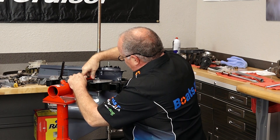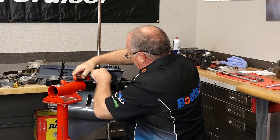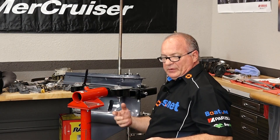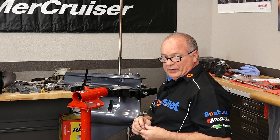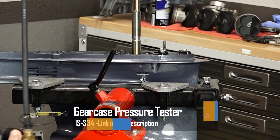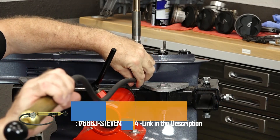What we're gonna do is remove the upper oil level check bolt. Then we're gonna attach it with the correct adapter, take it to around 12 to 13 psi, and let it sit there for about five minutes just to make sure all these seals are doing what they're supposed to be doing. Now when you go to order one of these, they make several different adapters — make sure that you order the one you're gonna need for your particular application.